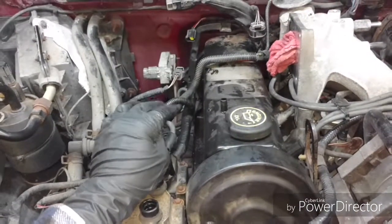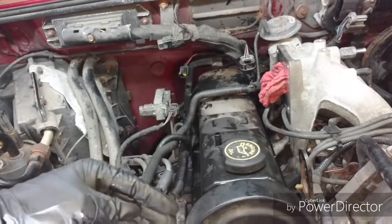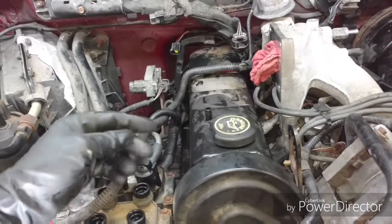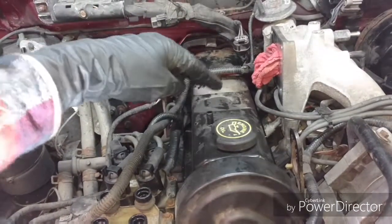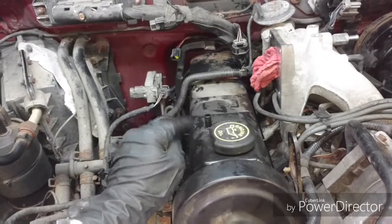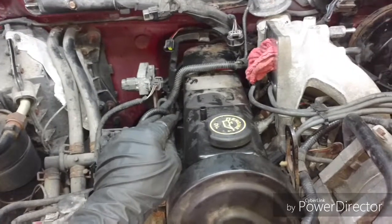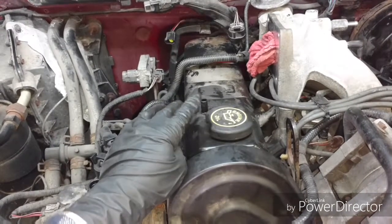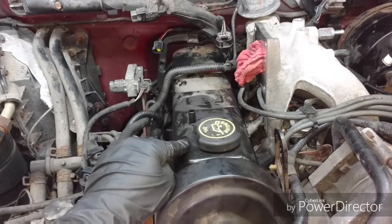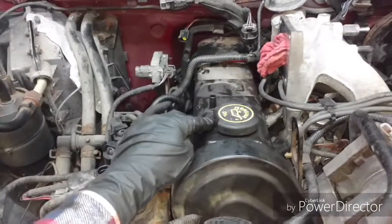Now I'm going around with a dry rag, wiping everything down and getting into all the crevices to break up debris as much as possible. Then I'll grab the air hose and take about 120 PSI to the entire engine bay to blow all that loose debris away. I don't want anything falling down inside the engine when I pull the valve cover off and knock wires around. I'm going to flush the engine with oil anyway and do a fresh oil change, but I want to change all the gaskets first.